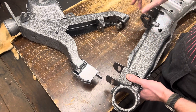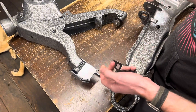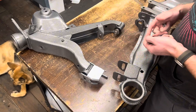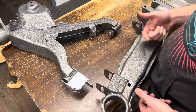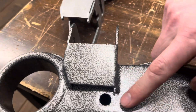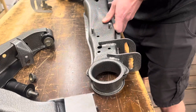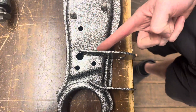With everything clamped down and in position, I TIG welded some tacks on this, then articulated it to make sure everything was good. I pulled out the bolt on the outside, moved it down a notch, moved it down a notch, to make sure everything lined up the way I wanted it. Once I was sure, I went ahead and burned this in. I welded in those slits, welded across and down, then flipped it over — on the underside I welded inside and outside, welded across and down and around the outside.